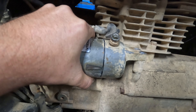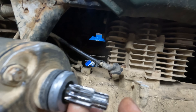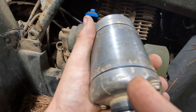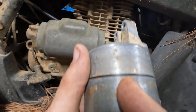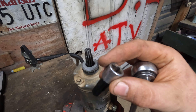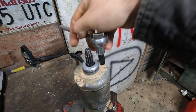You can wiggle the starter with your hand and push it all the way back and it'll come out. There's an O-ring right there that comes in the rebuild kit. Check your gears — this plugs into a bearing or bushing on the other side. On top there are two bolts; note the alignment lines on the front housing — keep those lined up when reassembling or the bolts won't go through. I'll clamp it in a vise and show what comes out.